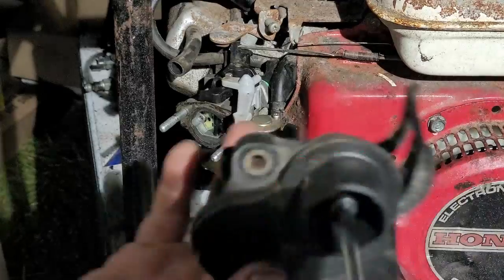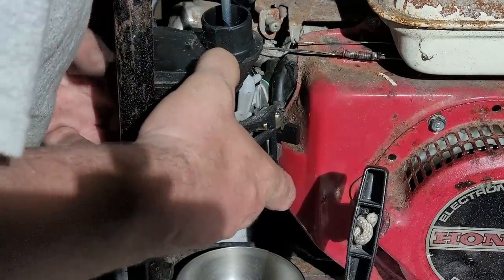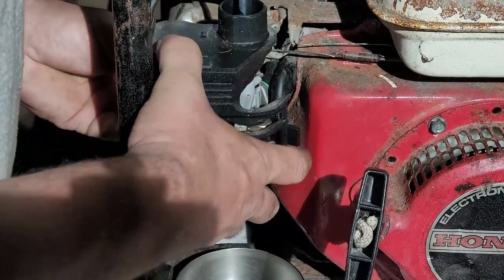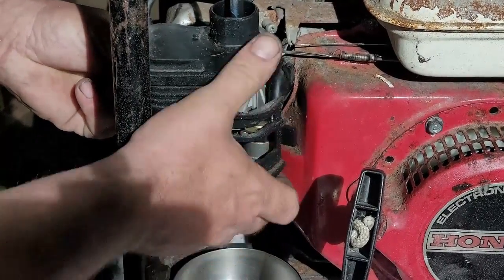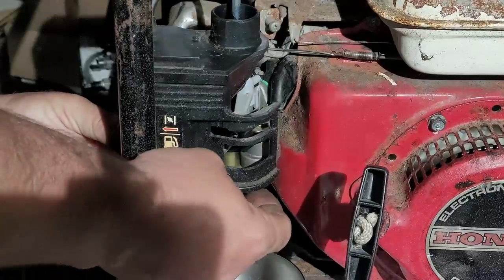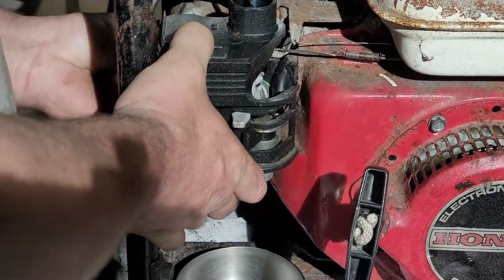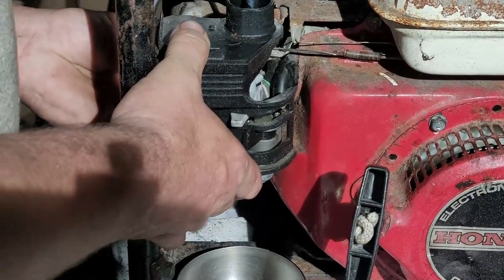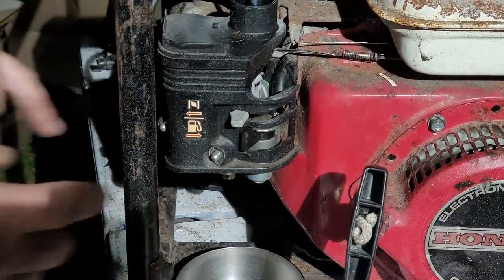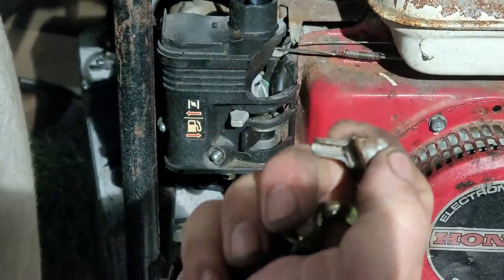Okay. Then we take the air filter box right here. Put that on. Help if I put the fuel on, it has to be on when you do that so it fits through the window. Okay, and the little vent line from the valve cover has to go on to it. Come on, get on there. There you go. Okay, and now I put my two little nuts back on there. There, boom, boom, boom. There. Okay.